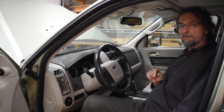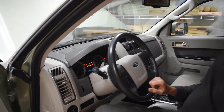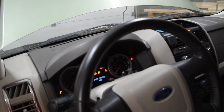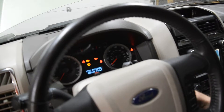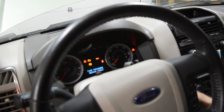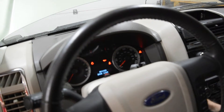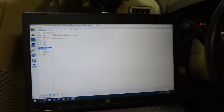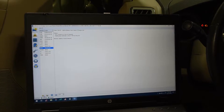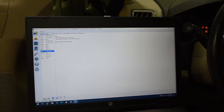Here's what you're going to find in your car if you have that condition. When you turn the ignition on, it will say "stop safely now" in the display. It shows the little service wrench and it shows the triangle of death. If you try to start it, nothing is happening — the vehicle will not start. If you have that condition, it's a good idea to do a quick fault code readout and see if there's anything else that might hinder the vehicle from starting.